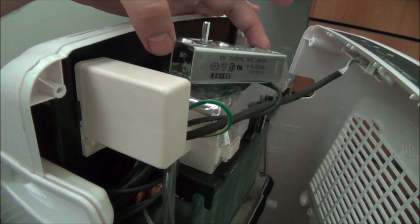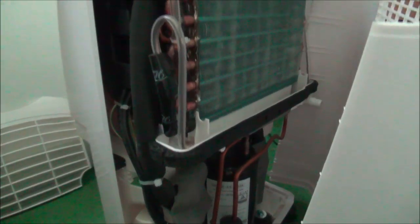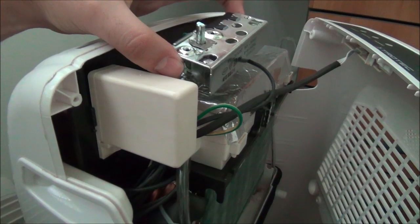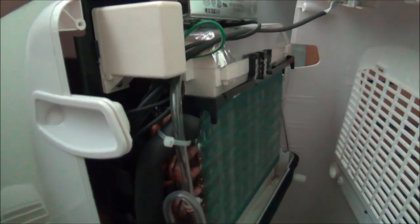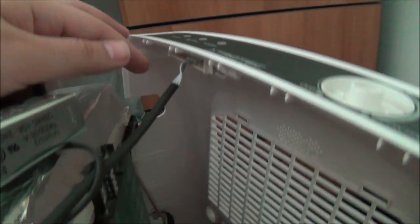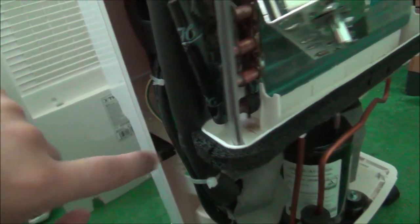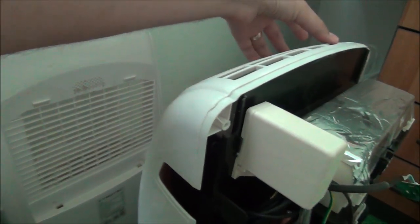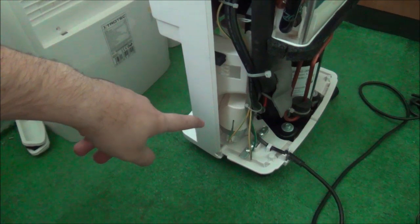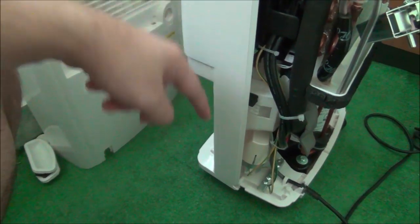And I think this is the humidistat itself, so this is probably giving - I don't know if it's cutting power 100% directly or giving some info to another electronics board, but it might actually just cut power directly. Obviously here we have the connector for the LED, so we need to undo that before we can take out this back part. After undoing one screw right here and one symmetric on the other side, this front part will start to come out. But be sure to undo the four clips in the bottom that hold it in place, so don't pull on it too forcefully until those clips are released.